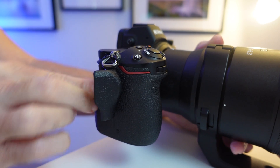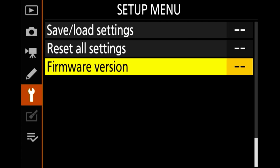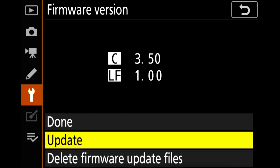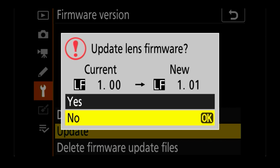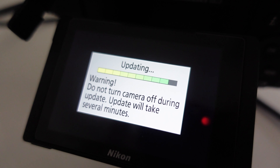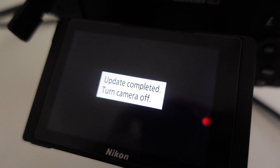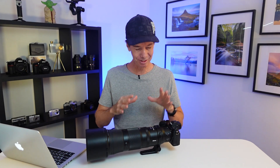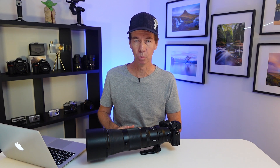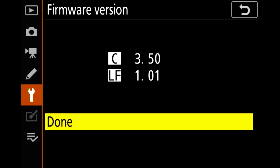With the lens still connected to the camera, turn your camera back on. In your menu go back to the firmware version and you'll see now we have an update tab. Click on that update and you'll be prompted to update the lens from 1.00 to 1.01. Click OK on that and let the camera do its thing until the firmware update is finished. Then turn your camera off and back on again, go to firmware version to check that it's worked — and there you go, the lens firmware is now saying version 1.01.